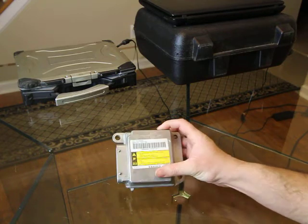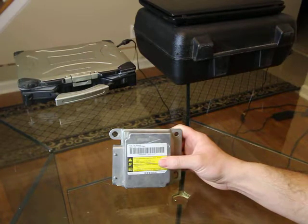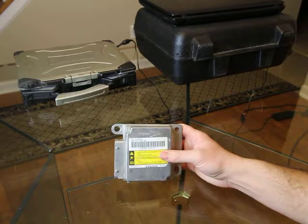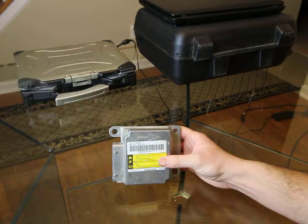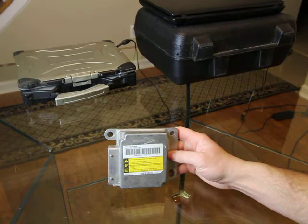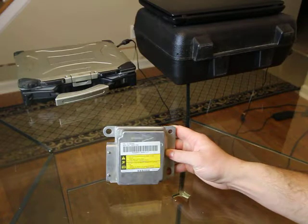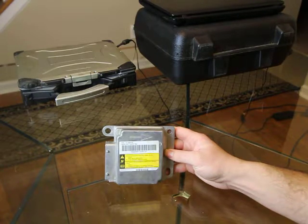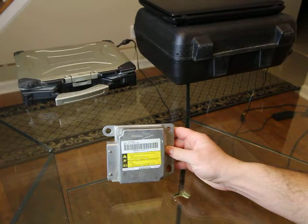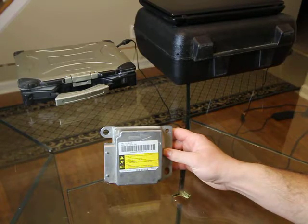So after you remove it, you might ask: why would I be sending you this module? Can't the dealer or shop reflash the airbag module after deployment? After a deployment, you'll see a hard code of B0051, which is the deployment-commanded code. The problem is these codes aren't meant to be cleared by the general consumer or a shop, since it's a safety item — in cases of litigation or a fatality, they want the information off this module to be untainted. However, a lot of times airbags go off in light impacts where there's no real precedent for needing the data off these things.